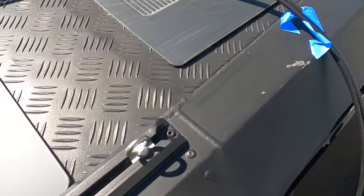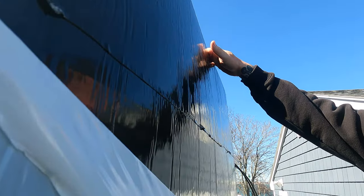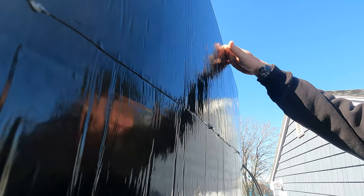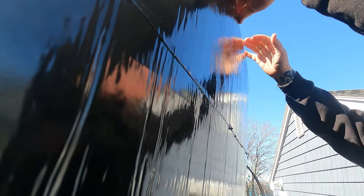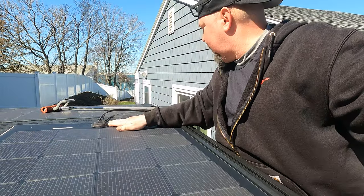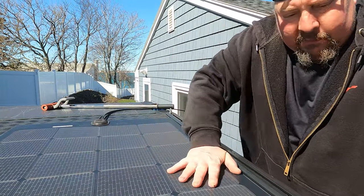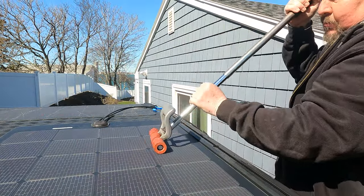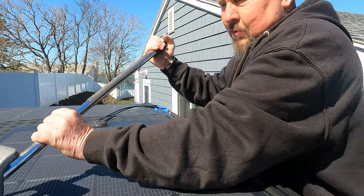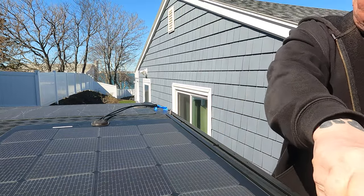You peel off these two huge white pieces of paper and it shows you the mastic or the adhesive, and this stuff sticks like nobody's business. I've had the other 110-watt Merlin panel on my roof for I believe three years, and it's never even sort of come off — not even a little bit. So when you put it down, make sure the surface is really clean, make sure it's sunny out because the heat is your friend, and make sure when you place it it's where you want it. Then I took a vinyl flooring roller and rolled it down after I had it in place.